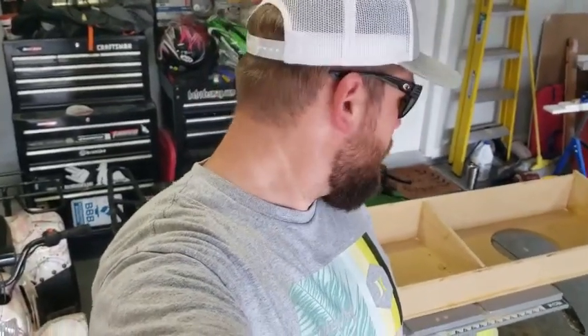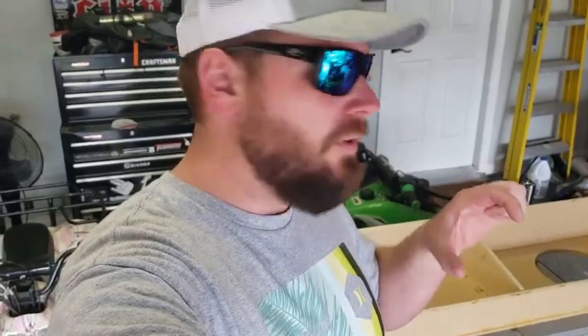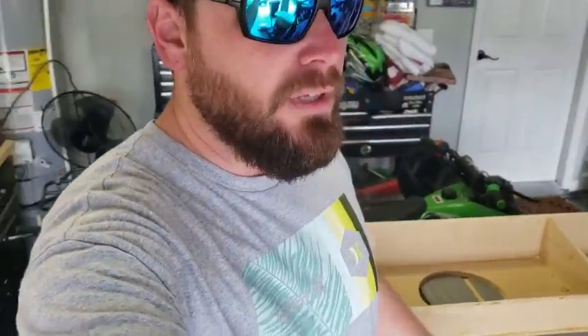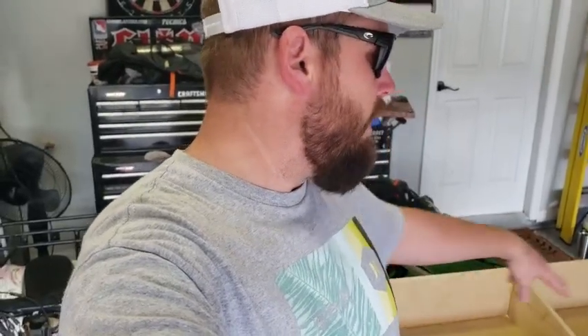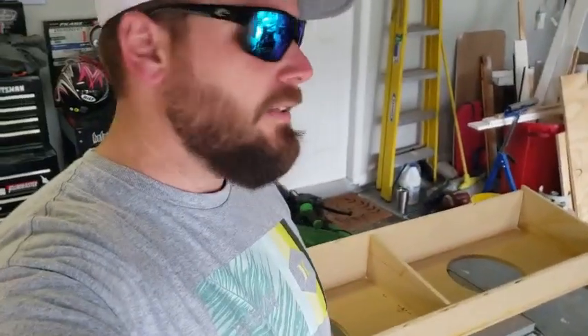We're going to keep moving. I just got back from the store — it's been about two hours letting the glue tack up and dry. I'm going to start hitting it with black silicone to do all the edges. I ran to the store to get a terminal to wire it in. These are Pioneer subs — if you haven't guessed already, they're 4-ohm subs. We're going to be wiring them in parallel, so the hookup will be 2 ohm. I'll have to drill a hole down through the brace to connect them together, and there will only be one terminal out the side.